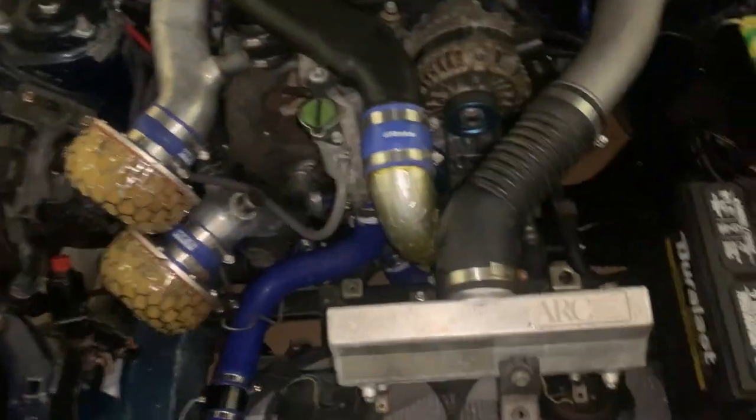We fixed the wire that runs the coolant sensor, so I have extra wiring in the car for extra length. We did some wire repairs down by the ECU and swapped out the fuse for the meter, which actually controls the cooling fans as well. So now when I turn on my key, we get everything, which makes me very happy.